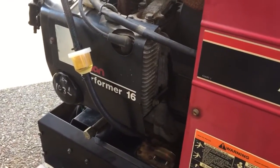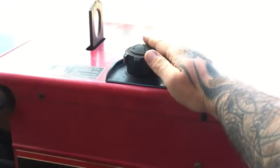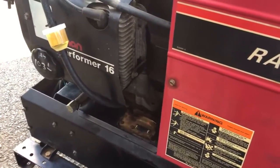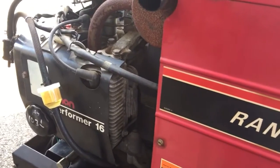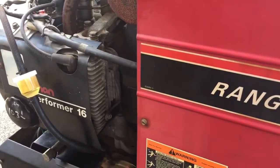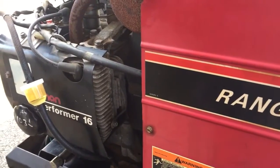So we did that, put a new fuel filter on it, and I put good gas in it. Early on in the video, I had a clip where I was going into the local drag strip where my fuel guy is, and I use what's called an MS-98L — it's from VP Racing, that's their number for it. Non-ethanol, of course, and it's about a 96, 98 octane, somewhere in there.